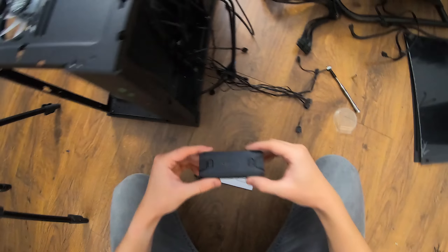The build's slowly coming along. We have a fan controller here from Antec for the three bottom fans, and it comes with a little booklet so I know exactly how to wire all of this up. So we have all six wires from our three fans. In order to control all the RGB lighting effects, let's wire up all the RGB connectors. Then we need our fan controller as well — basically just a fan splitter — and there we go, everything is wired up.